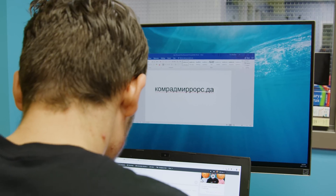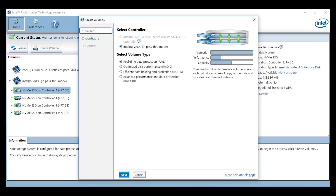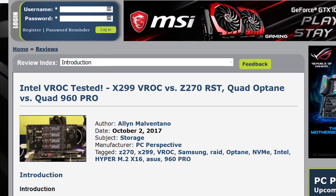Meanwhile, we hadn't entirely given up on VROC. While I wouldn't recommend getting your Intel drivers from Russian download mirrors, we did find one that claimed to enable VROC without a RAID key — and it technically worked. But our performance numbers were way off compared to the guys at PC Perspective, who also got VROC working via a similar method. And neither of us could get it to boot with non-Intel SSDs. So, back to AMD Threadripper, which for better or worse has bootable RAID today.